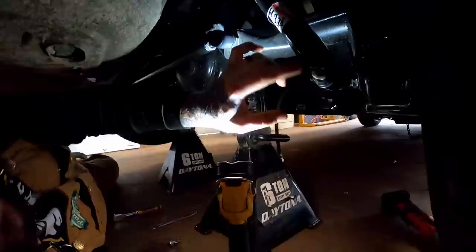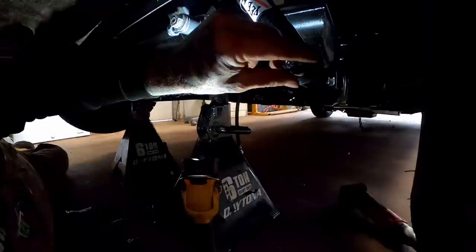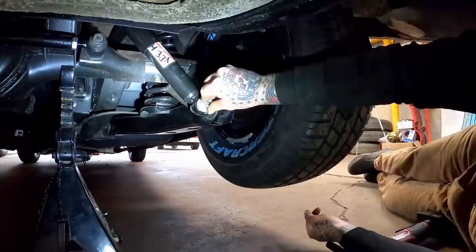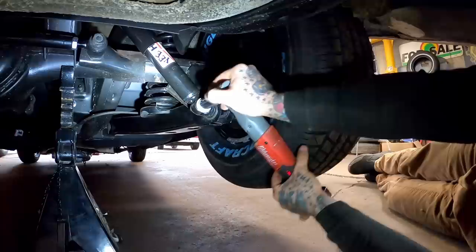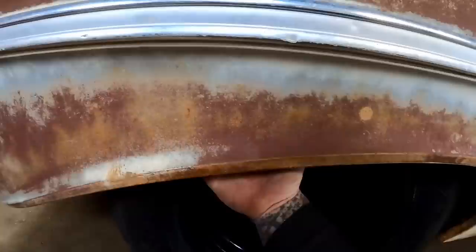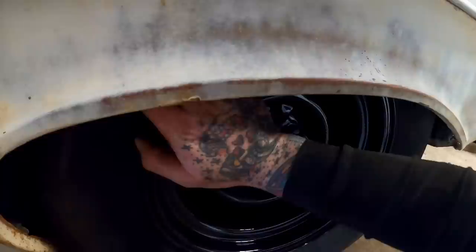This thing's gonna tow a trailer house. Got the top ones tightened up, now down here we can just put them on the studs. Did a little digging around and look what I found - I already had some new nuts here. Oh yeah, she ain't so bouncy now, she ain't like a trampoline anymore. Next, since we've got the axle on jack stands with weight on it back there, we want to check her side to side. We ain't even got to measure anything crazy at first - we can go pretty caveman. Almost perfect on this side, but on this side I can't get my fingers through there.